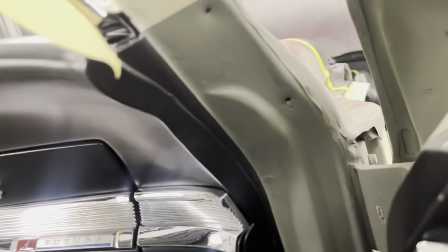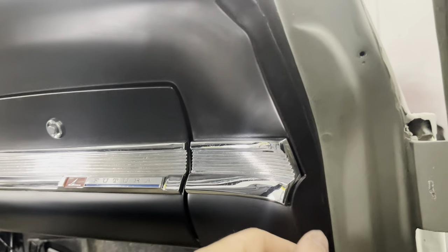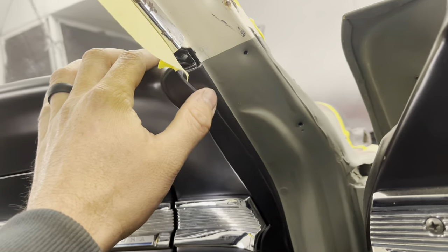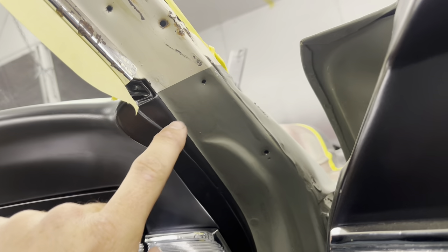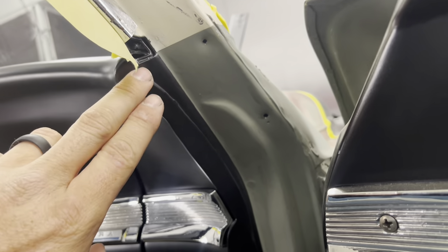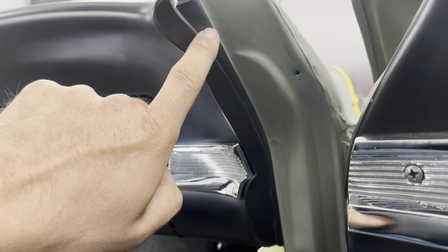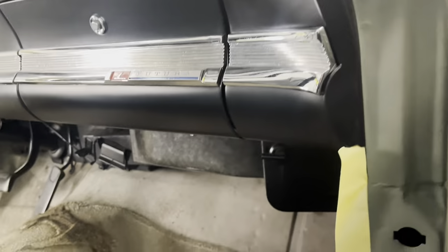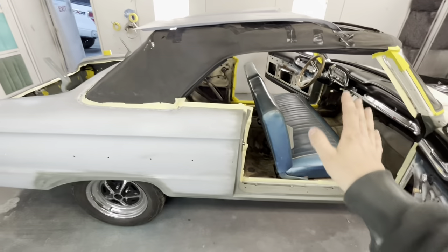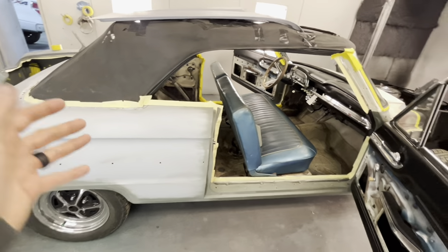Right here where it's spray paint, it's all metal spray paint, and there's an edge but you can't get anything behind it — it's all one piece. I don't know if this dash comes out of this car. It looks like it's overlapped onto metal — a really clean overlap — but there's no lip you can back tape. So we'll cut our plastic rough right here and then face tape to the black, following his line. I'll run a piece of half-inch first so my line is perfect, then face tape to that. The doors we'll do separately — we'll drop plastic, get the shell done, then move to the doors.